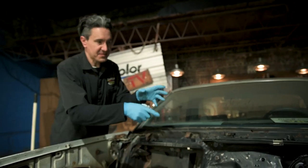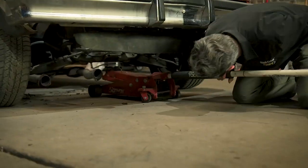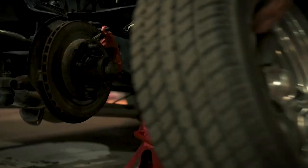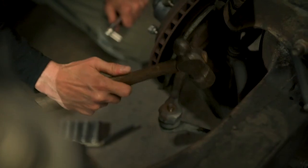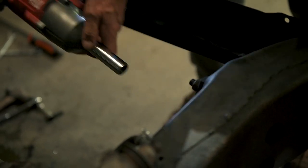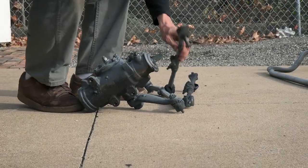Once we're finished wiping things down, we'll mask off everything we don't want to get paint on and then we'll be good to go. To give us better access to the frame and suspension, we jack the car up and remove both front wheels. This gives us plenty of room before painting and helps with any final prep and cleaning before laying down the masking paper. We also removed the steering linkage, gearbox, and stabilizer bar to blast 40 years of sludge off those components, since they will also be getting a fresh coat of paint.